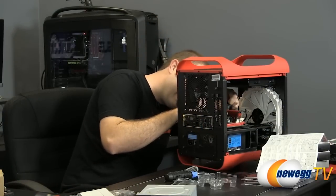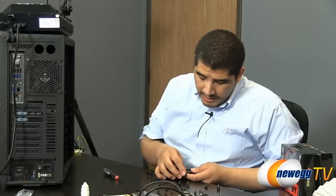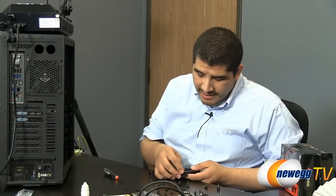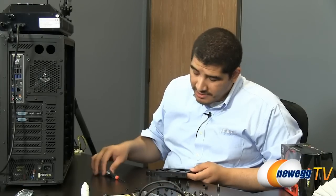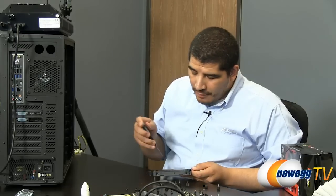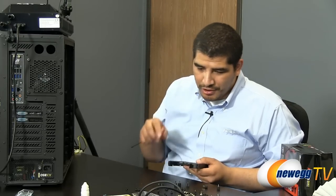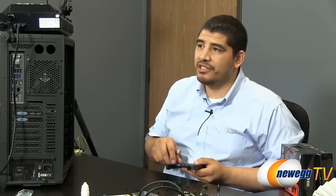I think that would get you a large amount of the way there. An SSD in itself is going to give you a huge amount of that response and snappiness that you're looking for from a system. The processor is not going to be too much of a bottleneck, but depending on how much they do on the web, if there's somebody that likes to go to YouTube and click on 1080p video, or they watch Netflix, which uses variable compression when it's streaming out to you, the processor has to be involved in that. But if you can get a fairly decent GPU to accelerate some of that, that can help to offset some of those experience aspects.